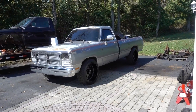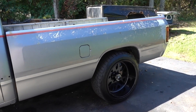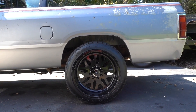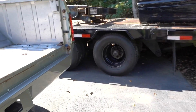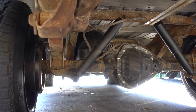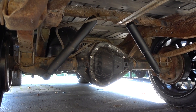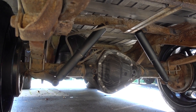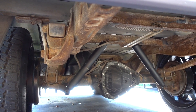My plan is to get the bed off, because not only is it gonna help us get that stuff apart, but it's also going to help us figure out relocating the rear shocks. The second gen axles have shock locations — one goes towards the back, one goes towards the front on the other side. The first gens have a different, funky setup. The shock location on the first gen has a little bit different pattern; they use the bottom sides of the leaf spring mounts and that crossbar. We're definitely gonna have to relocate and figure out some shock stuff. Getting the bed off will give us a better idea — we might even need to put a new bar across to mount them on top.